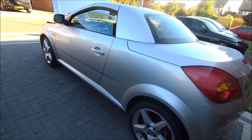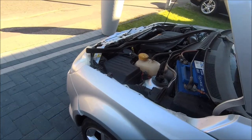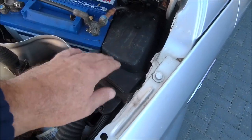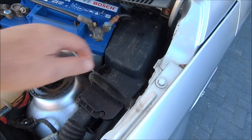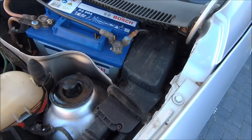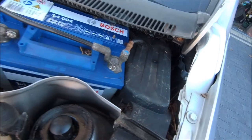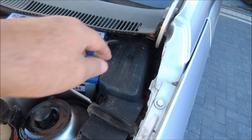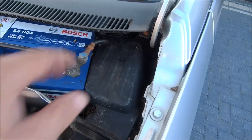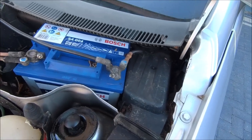Hello internet, another quick job on the Tigra today. They have a tendency of leaking through this box here — that's where all your fuses are and your body control module. They have a tendency of loads of crud getting in there and the seals rotting away, and then that lets water into the footwell because water tends to pull down here off the windscreen over that.